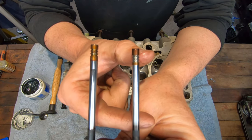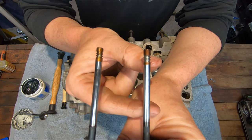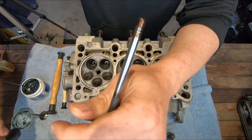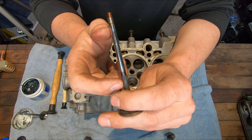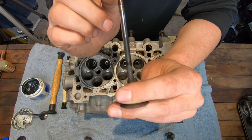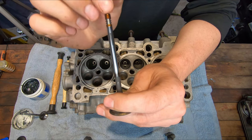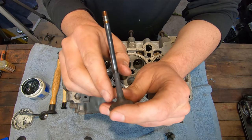What difference does that make? It means the exhaust valve spring is going to be just a little bit more compressed when the valve is seated, giving it a little bit more preload — making it effectively a little bit stronger. So by using the 2.7 valve in a performance application, especially for high RPM, that extra spring strength means it follows the cam better, and you can rev a little bit higher before you get valve float. Very good observation by our viewer. In my last video I said I would have run the 2.8 valves, but with that new information I've changed my mind — the 2.7 valve is the superior valve for a performance application, even though both are sodium filled.